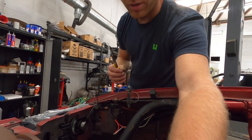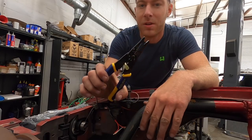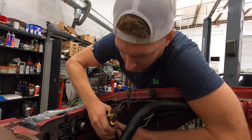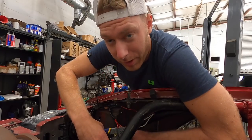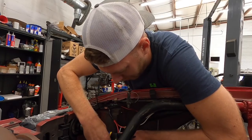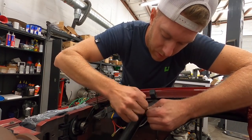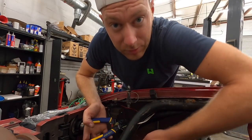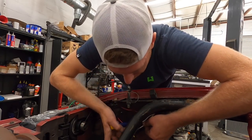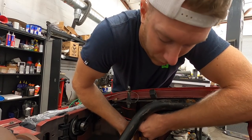As I'm extending the wiring for the headlights, IAC, and TPS, I'm going to show you a trick my dad taught me rewiring Christmas lights a squirrel chewed through back in Nebraska. You always hold your butt connector on your pliers first — that way you're not trying to twist the connector onto the wire. Feed your wires into the butt connector while it's on the pliers and it's a lot easier. Just like that, I pretty much have the headlights wired up and out of the way of the exhaust.